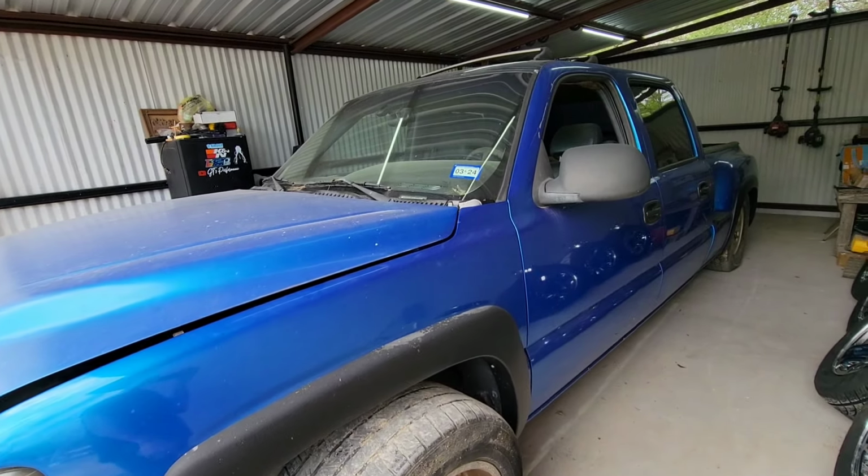All right, so here is the rear setup, and before I install the tire, there are a few things that I need to do. First off, I still have a jack stand and a jack, and you'll notice that I don't have a shock installed. So for that, I got these. These are the Belltech Street Performance, and here's the part number. These are anything between a 5 to a 7 inch drop. So I need to install some shocks.